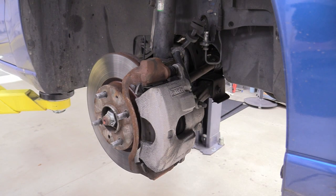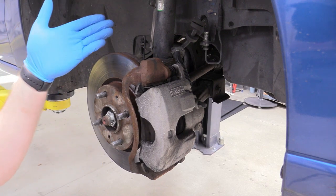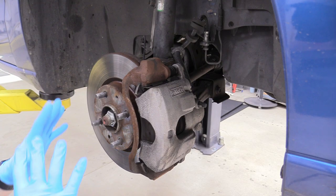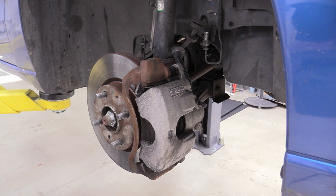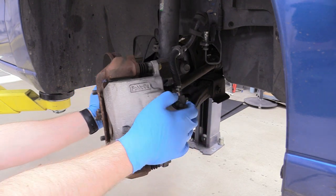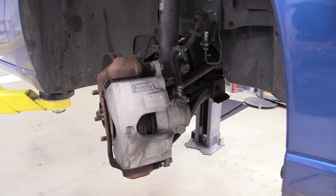Today I'm going to be replacing both sides on this car but I'm only going to show you one because it's exactly the same, just mirrored. I'm doing the passenger side — you do the exact same thing on the driver's side. With the wheel already off and the car safely jacked in the air — there's a link in the description for how to do that — I'll grab the rotor and turn it into a more workable position. Alternatively, you could just get inside and turn the steering wheel.